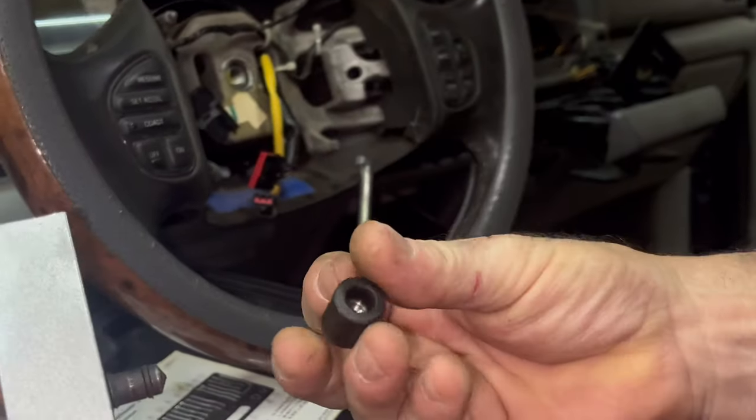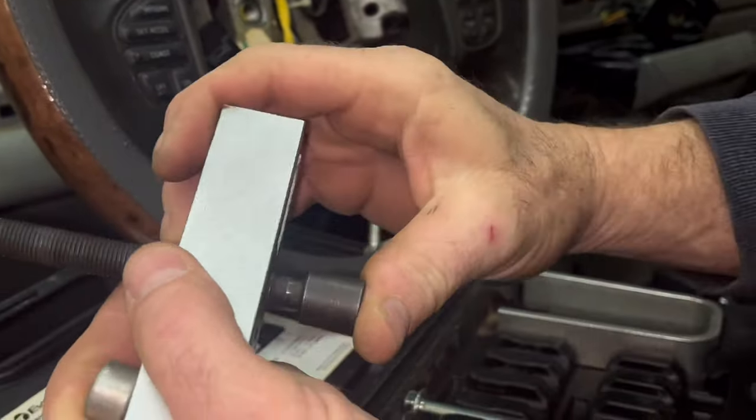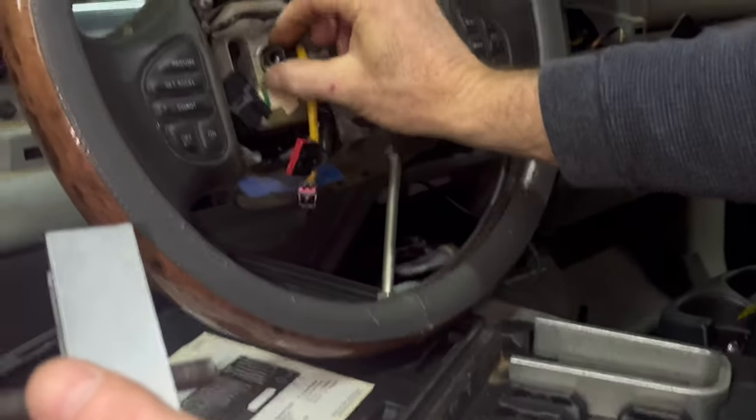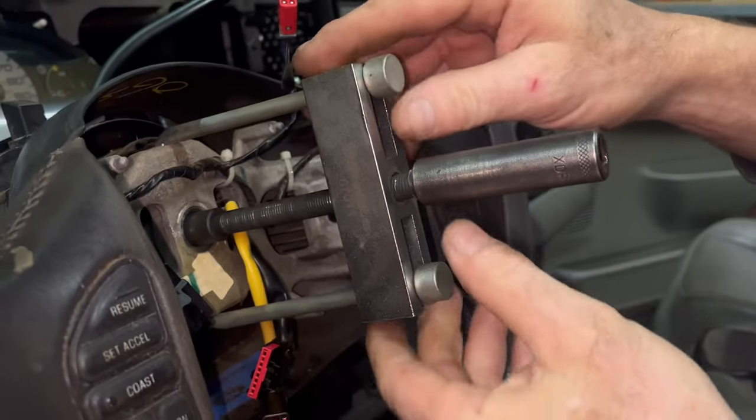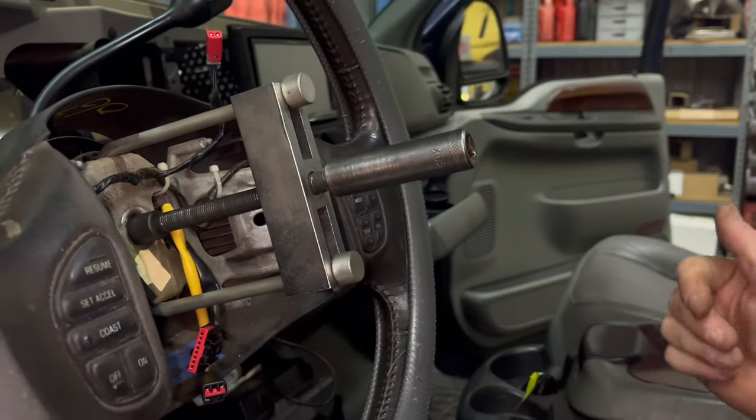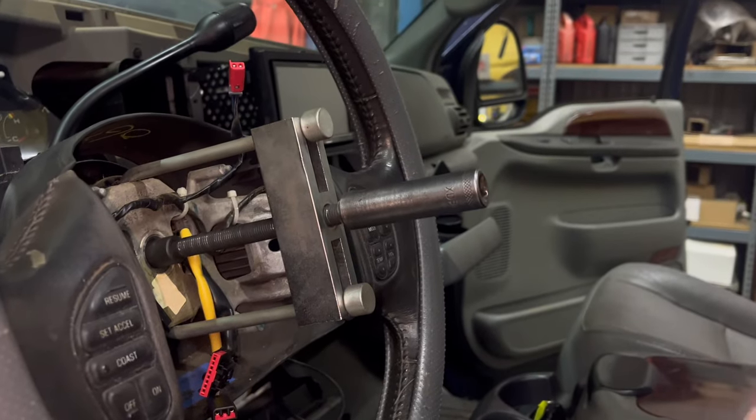It's almost not far enough. I remember it's not far enough because I've tried it from all kinds of different ways. You can go from the inside out, which is much more realistic, but you've got the clock spring that doesn't allow you to do it. I'm holding it back and threading this long son of a gun all the way in — the steering wheel puller's got a little O-ring flange on the end, a little cap that goes in there so we don't bugger up all the threads. We need a little oil on it.